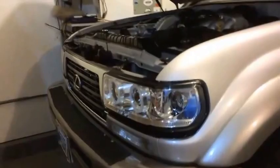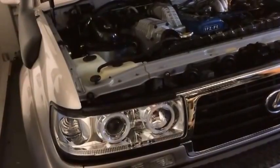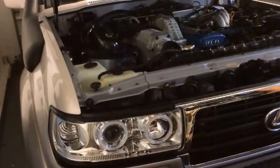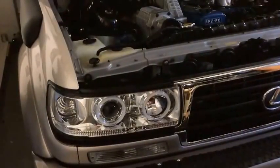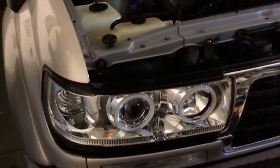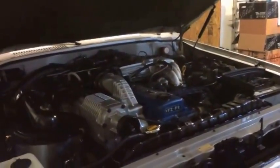If you have any questions, ask me. My advice: keep the original headlights and put in a 55W, 6,000-lumen bulb — you'll get more light than these projector lights. I'm not really pleased with the projector lights. Also, I'm not sure how long they'll last. Made in China, they may turn yellow in about three years, so I can't speak for their longevity.